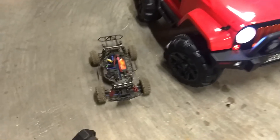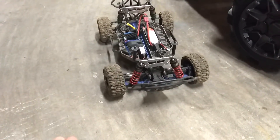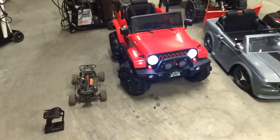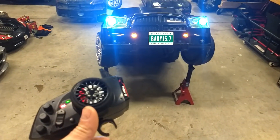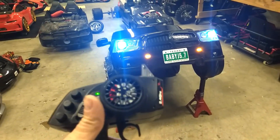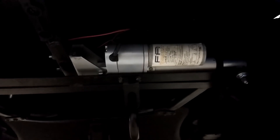Compare that to a real RC like this four-by-four slash — even though it has a wimpy servo, it self-centers. That's what you want so you're not constantly fiddling with the steering going back and forth. On this charger we'll fire it up — you always turn on your radio first. We wired this so it's on the key: turn it on, it clicks on a 40-amp relay. The steering self-centers when you let off — it always goes back to center. This is what we've got: a linear actuator.